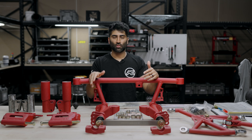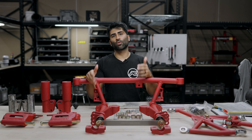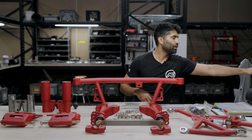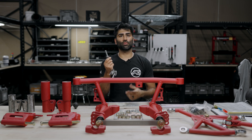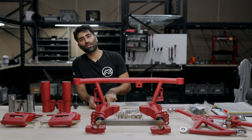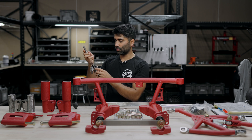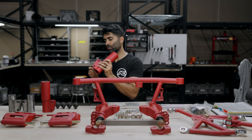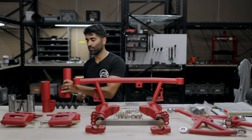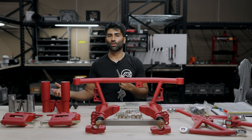The fourth part of our QC process is hole tolerance. There is a little bit of leeway, but we want to make sure the bolt is not so tight it's impossible to get through — some slight persuasion is acceptable by our standards — but also not so loose that the customer has excessive wiggle, which can cause suspension movement. All the hole tolerances are found in our QC handbook, and the QC person cross-references each hole using this ring with bolts cut down to match the exact bolts we use.